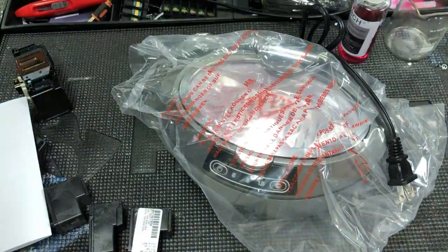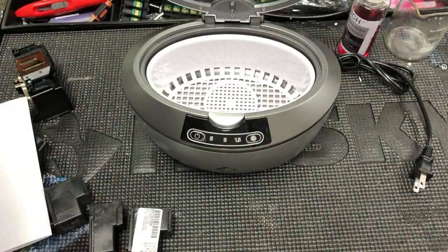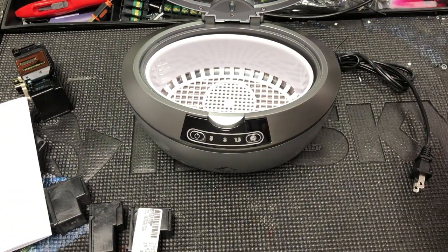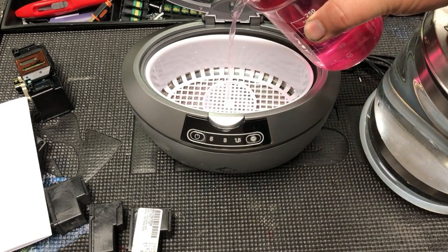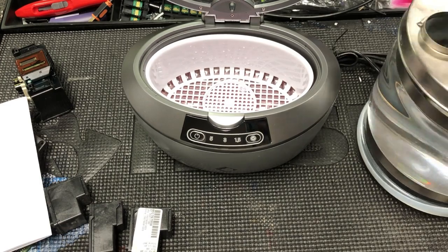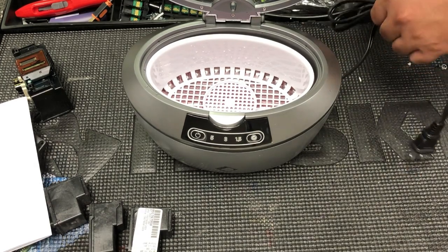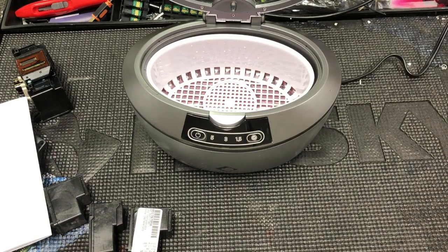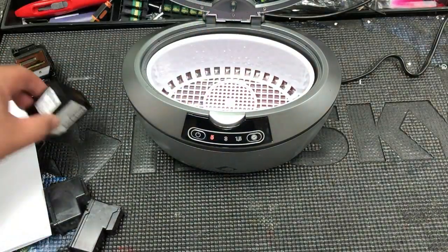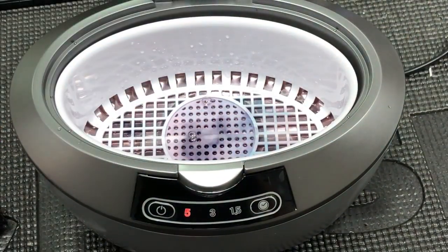The cleaner looks really well built. Here's the basket, and here's the watch stand. I'm going to use BCH cleaning solution — I'm going to dilute it five times: one part cleaning solution and five parts distilled water. We don't want to soak the whole thing in the solution, so we just have maybe a quarter inch above the basket, and now we put the printhead in it.